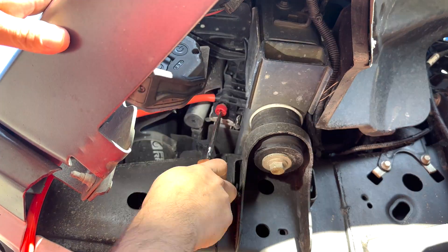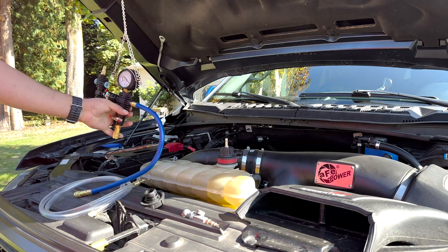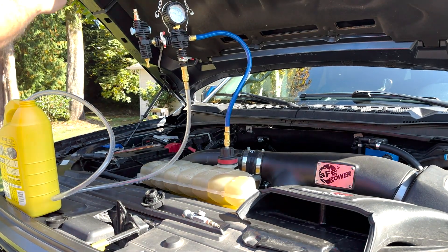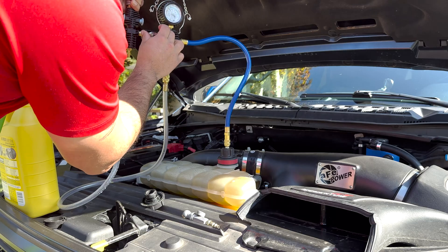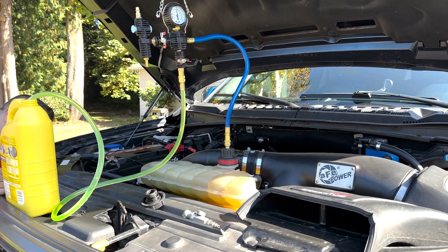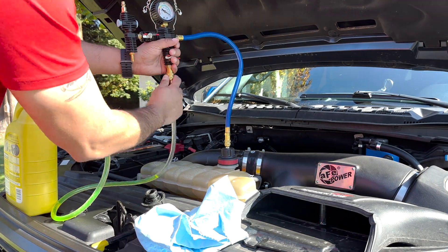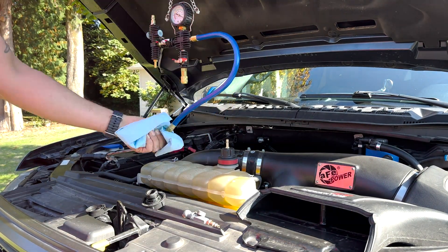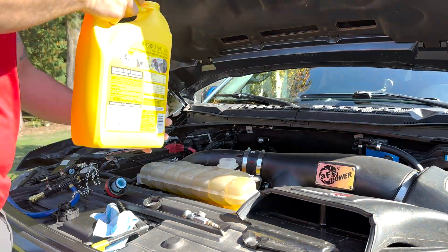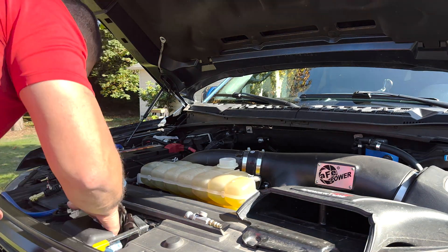I figured that it may be some air in the lines, and I was supposed to flush the coolant anyway, so I bought a vacuum flush kit, drained the coolant, hooked everything up, and did a drain and fill three times. Since the drain valve only releases coolant in the radiator, I couldn't find a better way to do this, and it's super time consuming since you have to run the car between each drain and fill. You're technically supposed to swap to water first so you know you've actually gotten all of the old coolant out, and then put new coolant in after that. I can't even imagine how many days that would take.